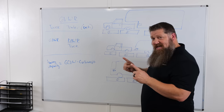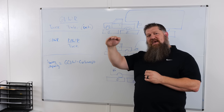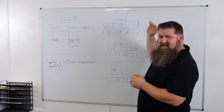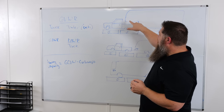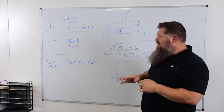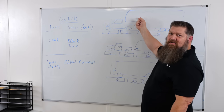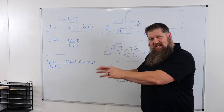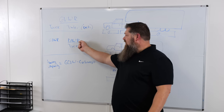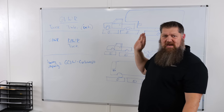The first weigh also gives you the weight of the pin actually on the truck. The second weigh is everything minus the trailer, so the difference between the first and second weigh tells you roughly how much weight is actually being transferred over to the truck as pin weight. Now look at the rear axle weight rating, because we're going to talk about shifting some of this weight around.